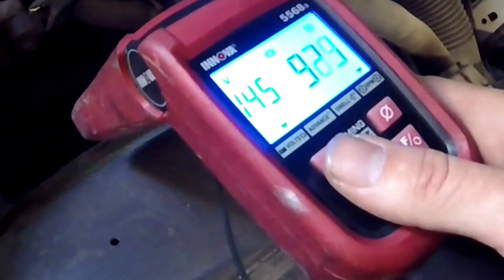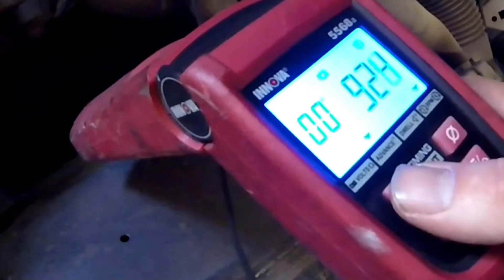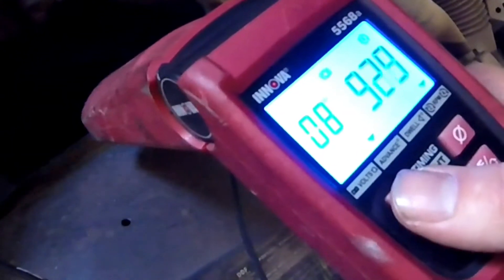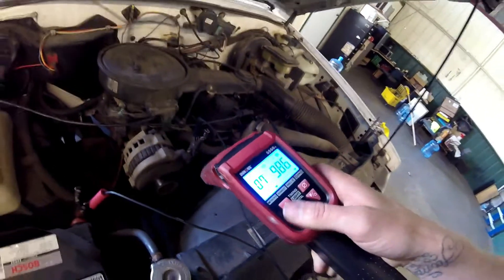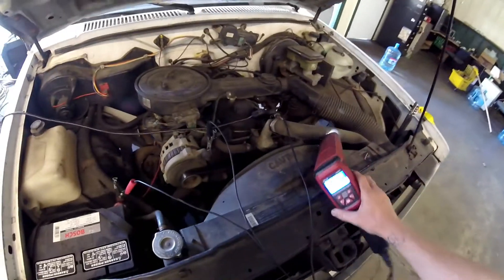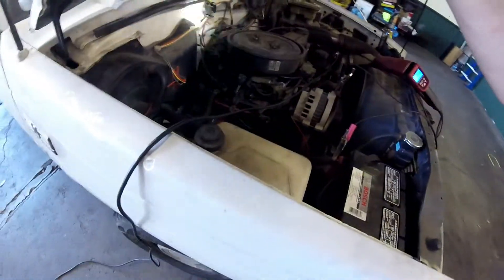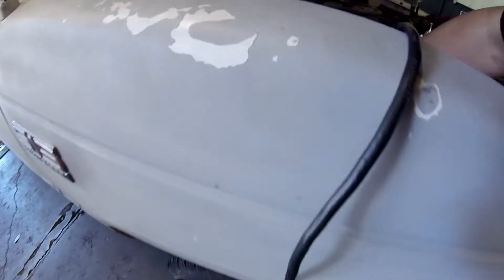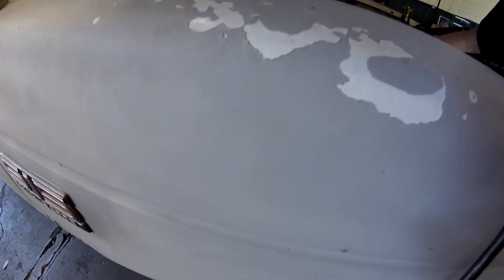Timing is supposed to be at eight degrees on this vehicle. Acceptable by the state is plus or minus three degrees. I'm using my timing gun right here to advance the timing to eight — that should bring the notch on the pulley to zero on the indicator. In this case it did. So without moving the timing with my gun, it lined up with number eight on the indicator. Move the gun to eight and it goes to zero, just to confirm.